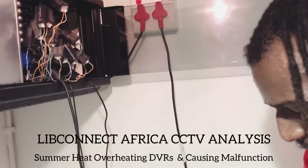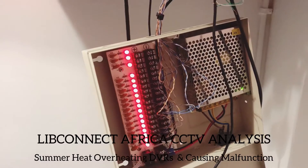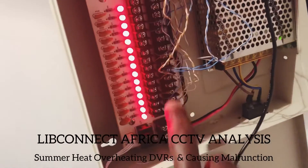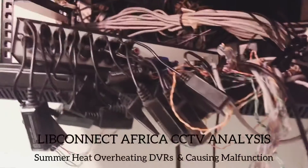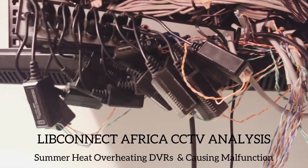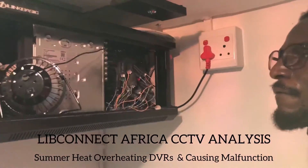Here is where the cameras are supposed to talk to the DVR. Some cameras are not connecting properly because these joints here are loose. To switch on the cameras I have to unscrew everything and screw everything back on, and then for the DVR to work I have to plug in the camera network cables into these connectors. Some of them are old and the cables are not touching nicely, so you find that some cameras are not seeing clearly because of poor connections here.